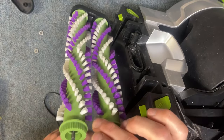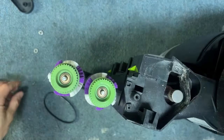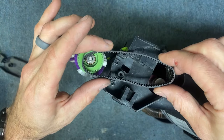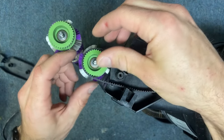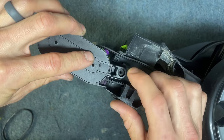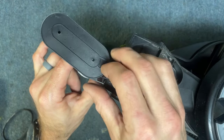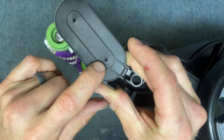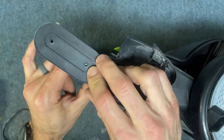If you turn one, the other one will turn. We can leave it on its side because it's probably easier — that way these won't slide out. Go ahead and put in your two stainless steel washers over on this end. Then you're going to take the longer geared belt and stick it around the motor pulley, and then stick it around your brush like that. Now it's this cover piece that actually keeps the belt under tension. First you can slide it right down and over the screw post. Then you're going to want to pull this brush roll out and put some tension on it as you're trying to line it up with the shaft. It's kind of hard to see because it covers — there's this little hole and you have to look down in there and you'll see this silver shiny part, and that's how you can kind of see that you lined it up.